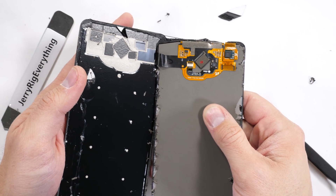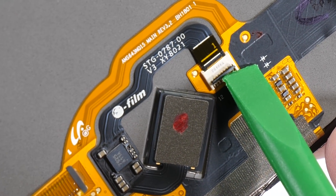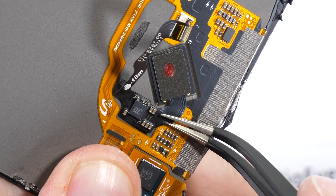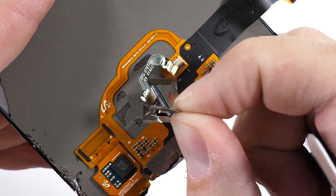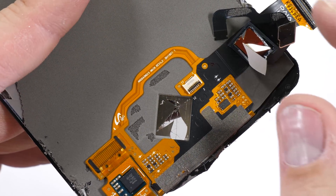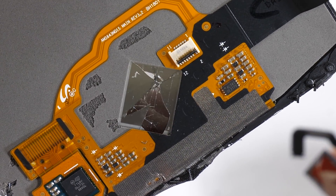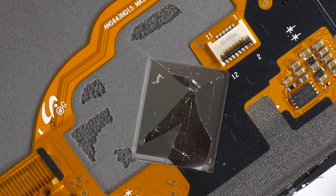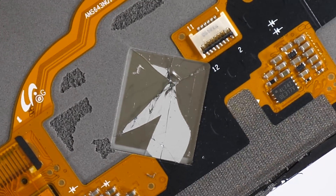Finally, we get to see the backside of the in-display fingerprint scanner. It's got a little latch-style connector tying it into the screen ribbon cable. I'll unlock that with my plastic pry tool and very carefully pull the fingerprint scanner up and away from the back of the screen. It's very lightly adhered to the slot that it's sitting in, and it is pulling away with some of the little bits of fragile AMOLED display attached to it. You can see inside the slot the screen has different layers — the clear glass layer on the outside, and then that brownish display layer made up of tiny LEDs that I compared to a fragile potato chip.